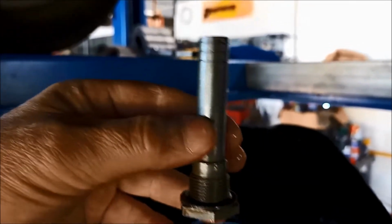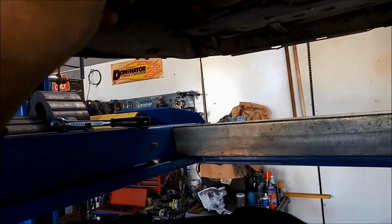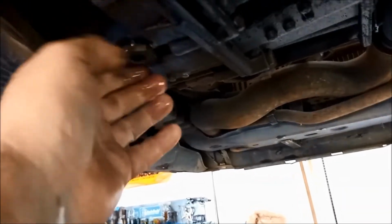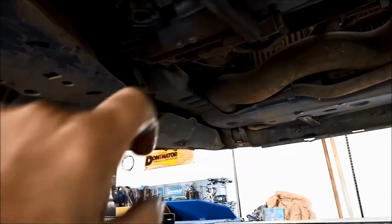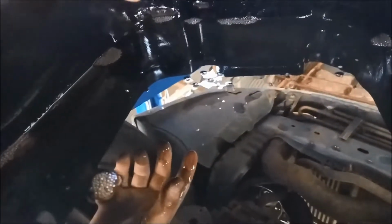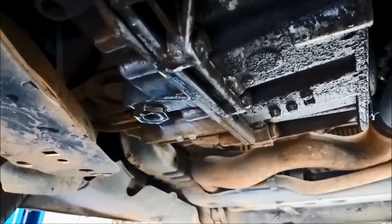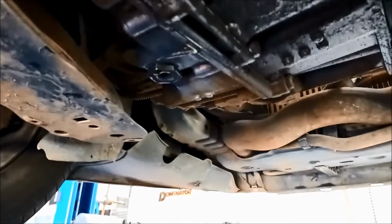And that's what the filler plug looks like, or the level plug. And what we do is we just put that in there like that, tighten that one up, and if you've got a fitting for the thread there, you can fill it through there, or you can just put a hose in there, and what you want to do is just slightly overfill it. You'll need probably to put in about 3.5 litres in. Get the transmission fluid between 35 and 50 degrees, and it should be just trickling out over the top of that little tube in there.